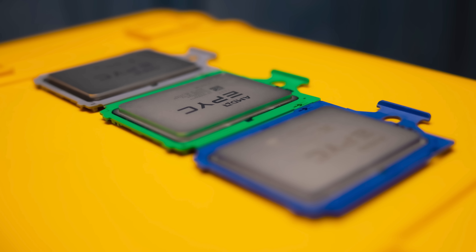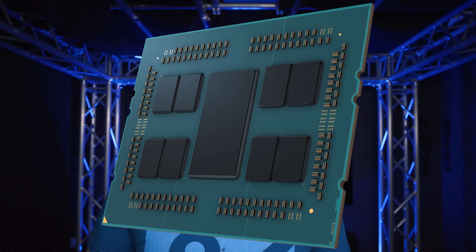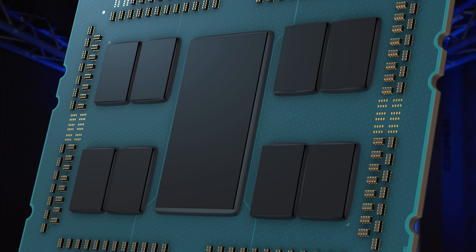But it's a relatively simplistic type of interconnect. And then the third way is really what AMD EPYC does — that's not necessarily a GPU, but really scaling out in terms of cores. They did something different where they have a bunch of dies, up to a total of nine dies right now, on a PCB that is basically the package for the CPU. You have PCB wires from all the different dies, and that's how you do the interconnect. That's an easier way to go about it, and AMD was able to get multi-die earlier by doing that.